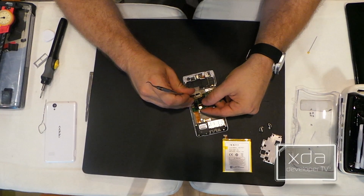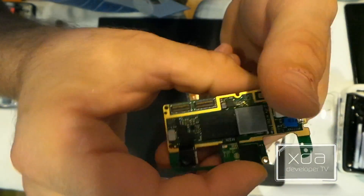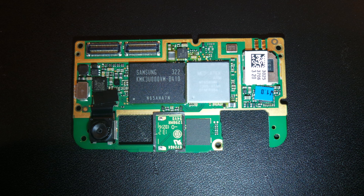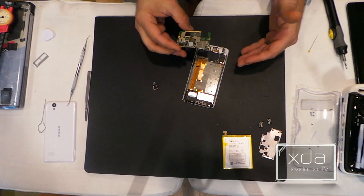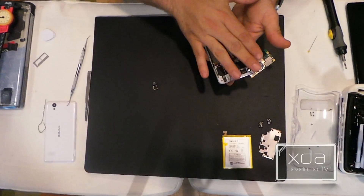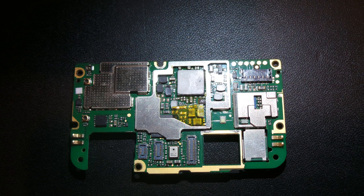And two more connectors on the back. Here's a little shot of the board for you guys — this is probably one of the smallest boards I've ever seen. Now, this board does have a fairly good amount of conformal coating on it. Although it doesn't have any impact zones, what I'm noticing is that the board is actually fit inside of a metal frame on the device, so when it's in this frame it actually resists impact via the structural form of the phone itself. This phone does have an aluminum frame all over it, which says to me that it would likely withstand impact fairly well.